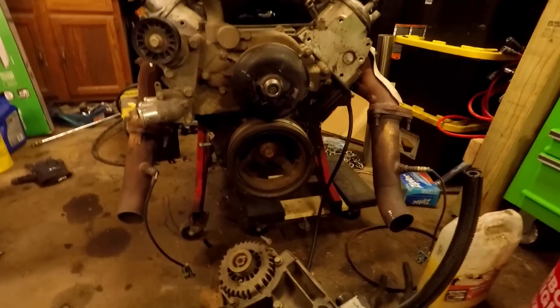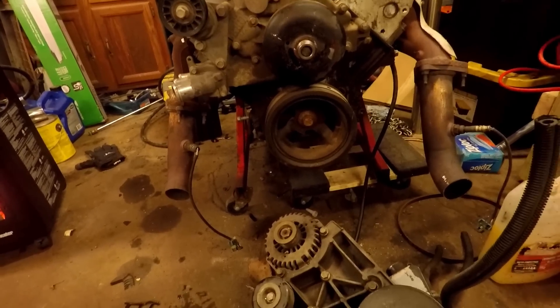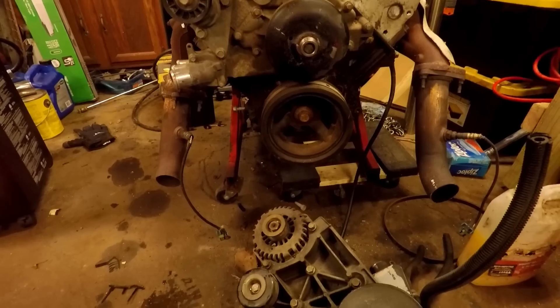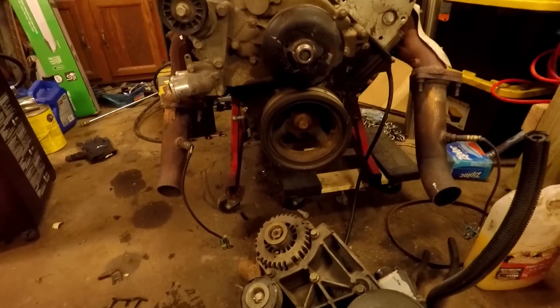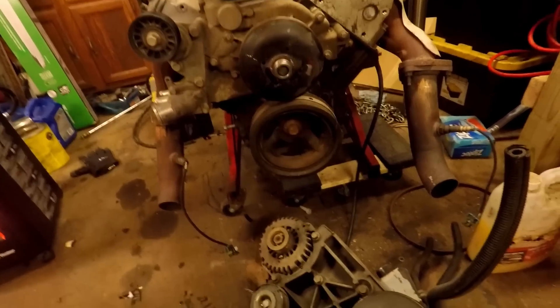Hopefully this gives you some ideas of what you're looking at and what you can do. If you have truck manifolds, this will hit a C10 because it's out so far, but you can cut it off and weld some pipe to it and get it where you need it to be. The big deal about this, again, is you get all that spark plug clearance — it's just like stock, so all your wires will go right down and fit and you won't have to redo all that, which is kind of a big deal to me. Hopefully you guys like and subscribe and we'll see you next time on Drive My Engineer. Look for the new turbo build and crossover build because I'll be doing that in the coming weeks. That's what I'll be working on.